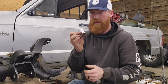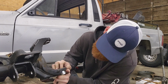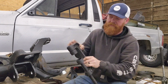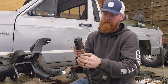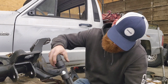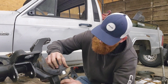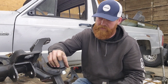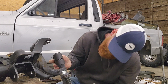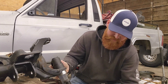We go to the bottom. It goes from the bottom up. Make sure it's setting straight before you start. And rotate these pieces because, again, they have a bit of a slant to it, and you want it to stay true. This is actually too big of a diameter, so I gotta get one that's a little bit smaller. Actually, this one I can use just the foot of the press here.